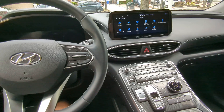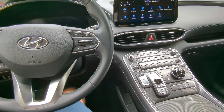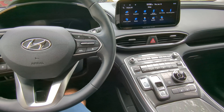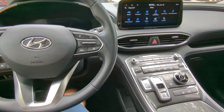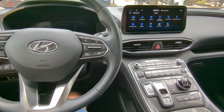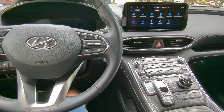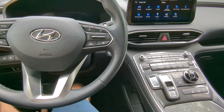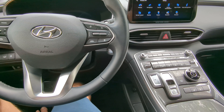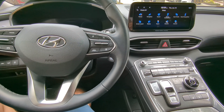So we'll just jump right into it. I'm going to provide links in the description below. The first thing you'll need to do is download the Hyundai Updater software — totally free. Once it's installed, I did it on a Windows 11 machine, and I'm sure it works on Mac as well. It'll ask you what type of car you have, what year it is, and so on. It'll then download all the installation files for the GPS, the firmware, and everything else locally to your disk.